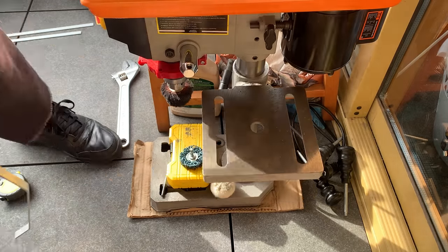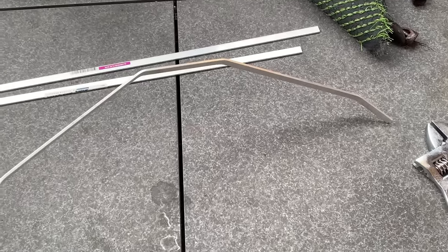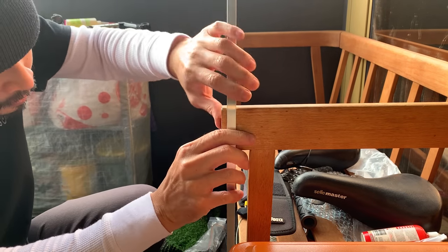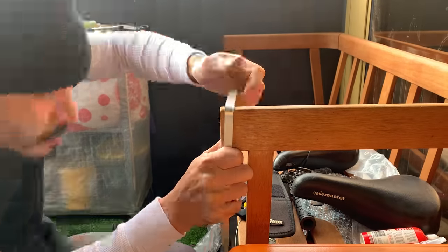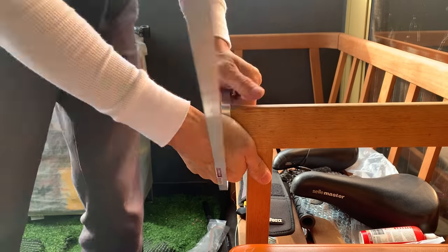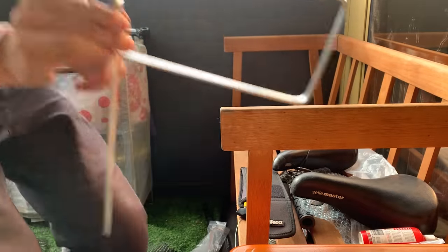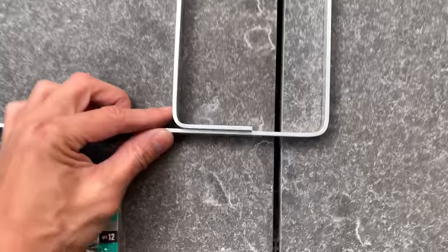Steel will be a little bit harder to bend — you might need a bit of heat. These are just pre-bends to get them to 90 degrees. What I do is put them on the side of my bench and use a lot of force to push it down. Just go slow — you don't want it to snap. Having the wider circumference at the corners helps with that. Here it's all done — pretty happy with the bends, I think it turned out pretty good.